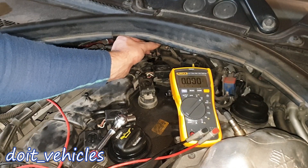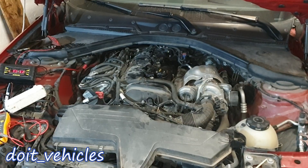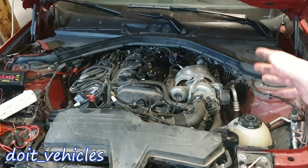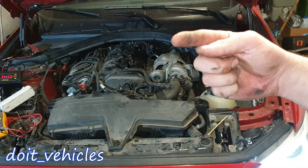This is the advantage of having two sensors of the same kind — you can compare the values. So that's how you can quickly check your camshaft sensors. This is going to be useful if, for example, you suspect that the Vanos is failing. It's definitely worth checking before you take the car to a workshop to fix your Vanos. Have a nice day and I will see you in the next video.